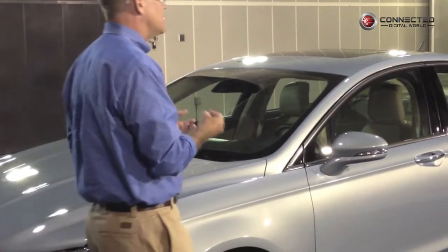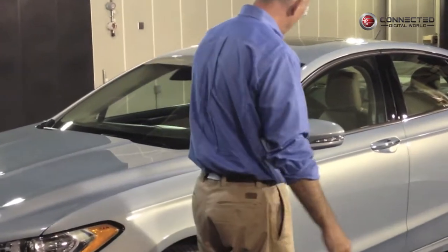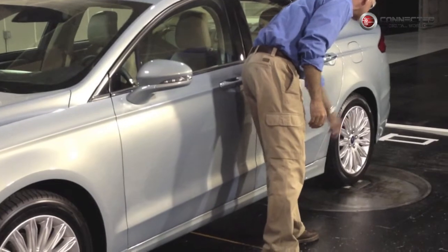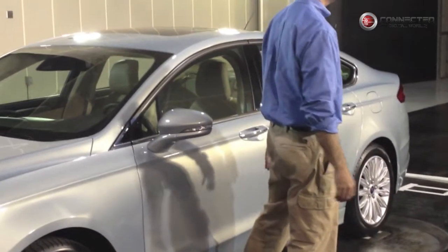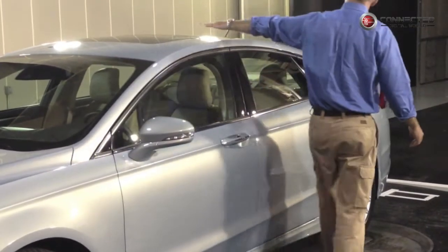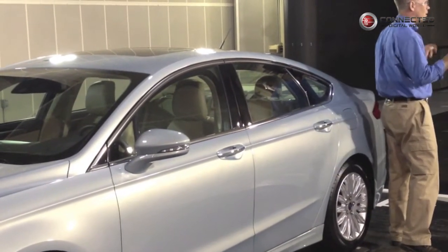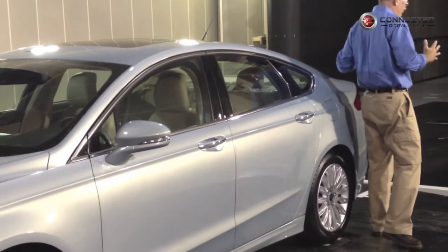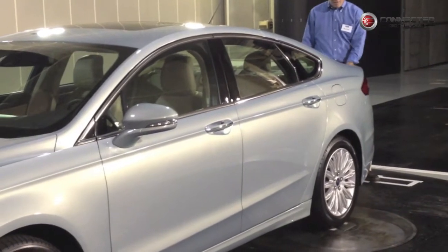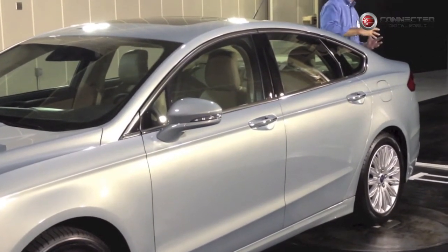But it's important — there are so many details in this vehicle that we had to optimize. Get the wipers down, optimize this angle right here, make sure that's correct. I mentioned the mirrors. Down along the rockers, we work heavily with the program and styling teams to make sure the air passes cleanly around the rear wheels, but also so you don't bump your pants on the rocker and get them dirty in winter. A lot of trade-offs, a lot of teams passionate about their attributes. Very important to get this angle so the flow comes down, goes off the deck lid very cleanly. We want to minimize the turbulence in the back — the wake — and pull that air back together as cleanly as possible. We've done a lot of work back here to make that wake zone as small as possible. This deck lid has a nice sharp edge, and working with these surfaces, everything makes that turbulence as small as possible.